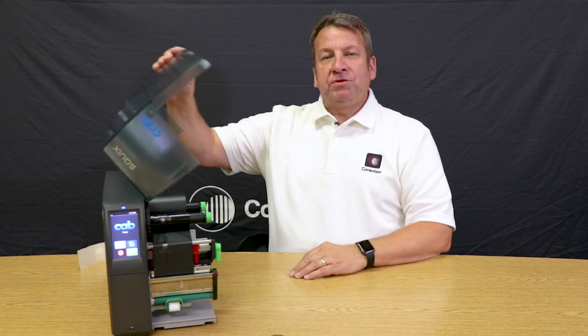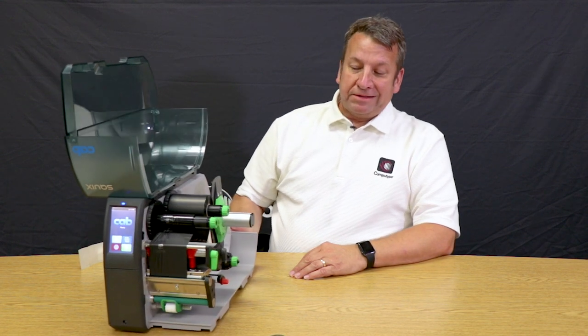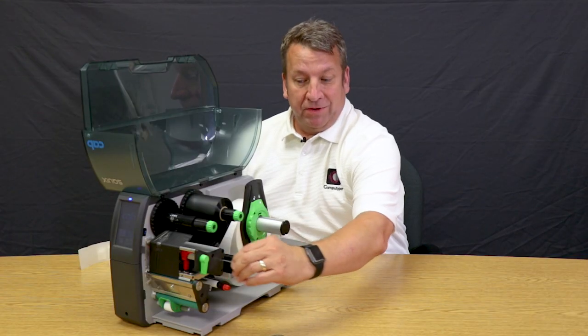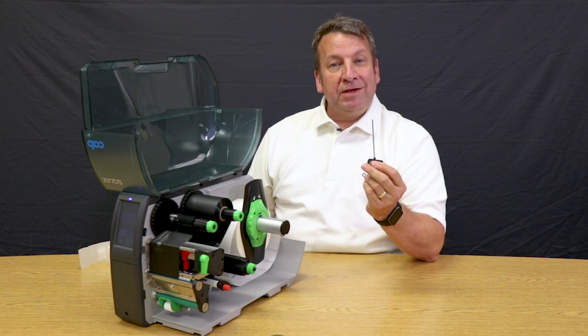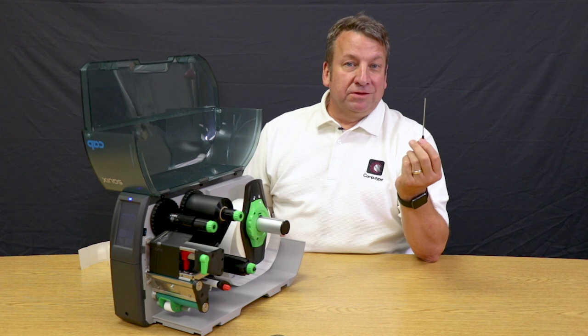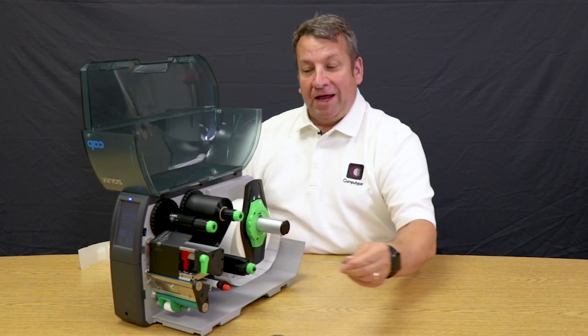I really do like the Squix printer, but it does have some limitations. This bi-fold cover that I like — I really wish it were metal for industrial applications. Also, there's a small tool that's so well hidden that a lot of people can't find it. This tool can adjust the printhead and printhead pressure, and in the wrong hands of someone who doesn't know what they're doing, they can misadjust the printer and cause print problems. I recommend removing this tool and keeping it in a desk drawer where a novice can't access it.